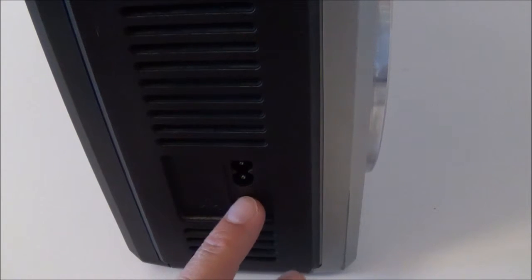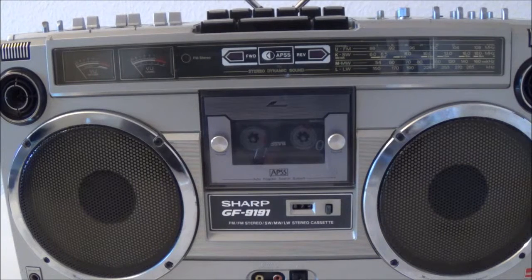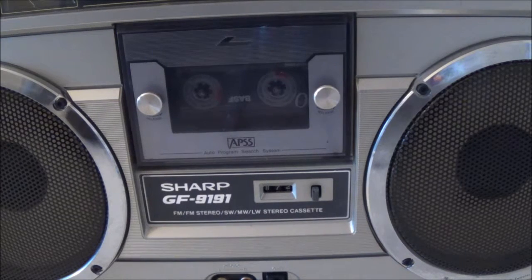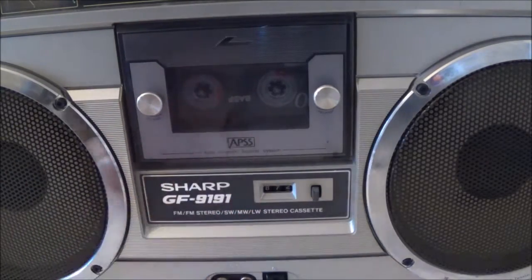I took a closer look and it says 15 volts input — I guess you could run it off a car battery. So in conclusion, this is a really nice machine, which I'm going to part with. If you ever wanted to buy one of these, what you'd have to look out for is that normally the belts are always bad. They're rubber belts and they just go bad after a certain number of years. You can expect to replace three belts if you wanted to use the cassette. There's also a little rubber pulley which disintegrates to goo — that would have to be replaced. As far as the cassette mechanism is concerned, you have to check if the pinch roller is good.